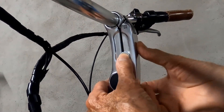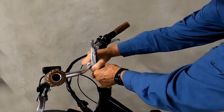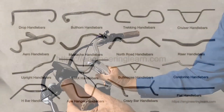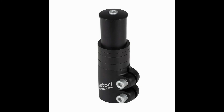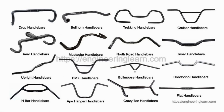There are also adjustable handlebars, like those found on the Pedego City Commuter. The key to their operation is the stem, which is fully adjustable without the need of any tools. They're useful for a bike shared by several people or if you like to change position during a day's bicycle touring. Limiting yourself to three handlebar styles is perhaps too simplistic — there's a wide variety of shapes. If you need your handlebar positioned higher or further back, you can ask your bike dealer to install a stem riser. Some stems are adjustable with a few turns of an Allen wrench, and if the handlebar isn't right, a replacement costs about $40.